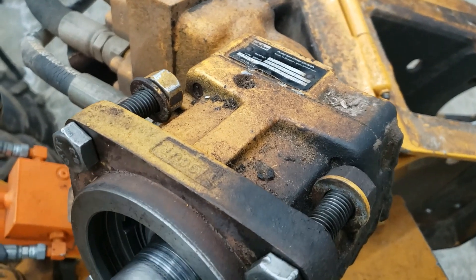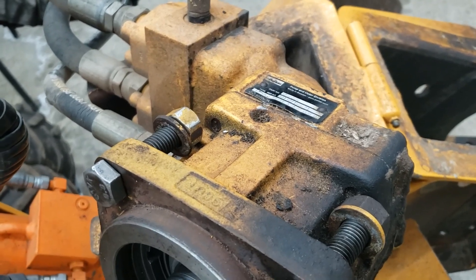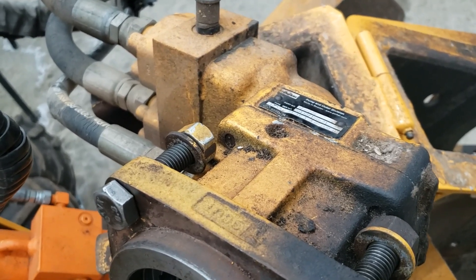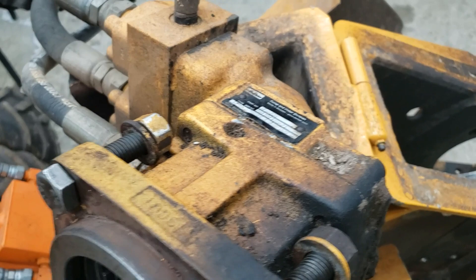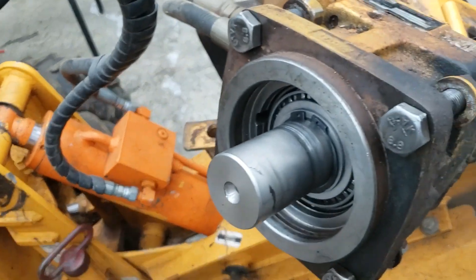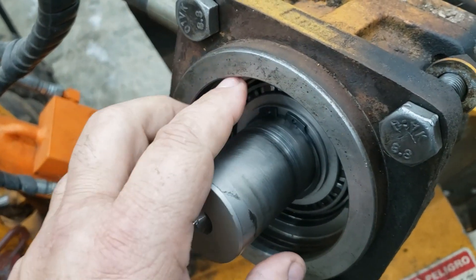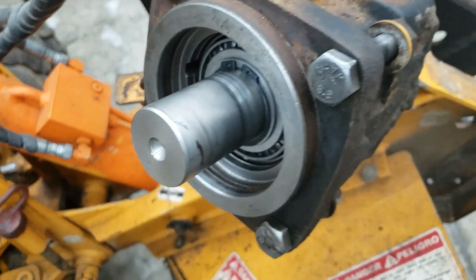My second parts guy — I don't like to talk bad about anybody, but the guy was acting like it was Monday morning, like I was doing him a favor by buying parts. Apparently they had two or three parts guys there and some of them are great, but there's always one. Maybe he was having a bad day. Anyway, you're going to need a punch set to get that oil seal out — be careful taking it out. And if you've got it apart, go ahead and order it and change that one too. Don't be cheap — being cheap costs you more work, then you've got to take the whole wheel off again.